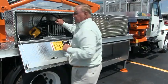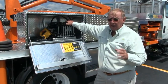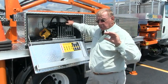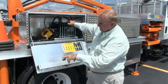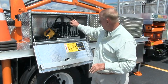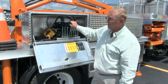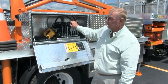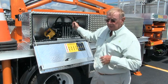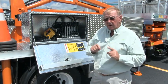We ask that you load the truck onto the outriggers because that will activate the control switches to activate the lift. We're lowered on the other side. You'll notice I leveled the truck, and the purpose of that is so that you can get your interlock system in play. Our interlock system is now in play.